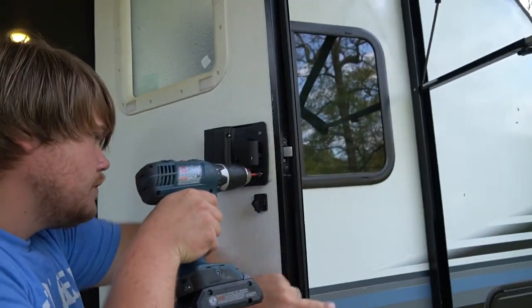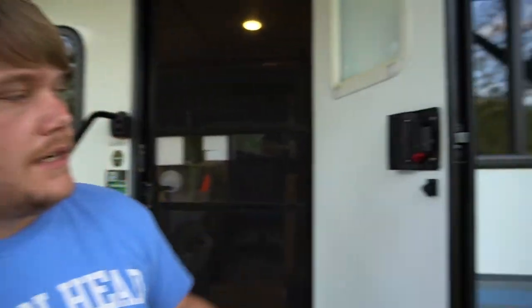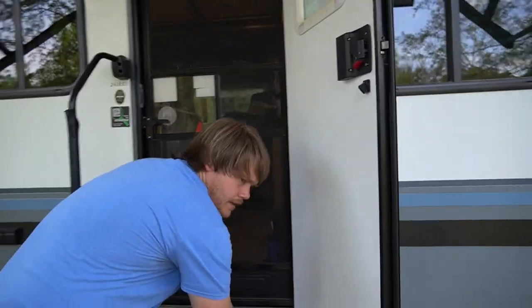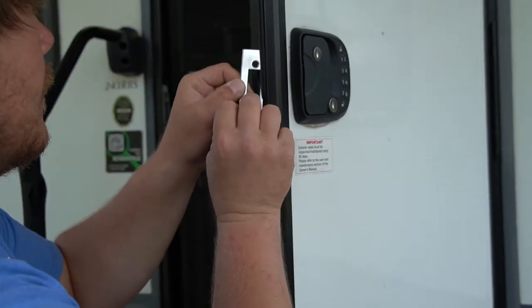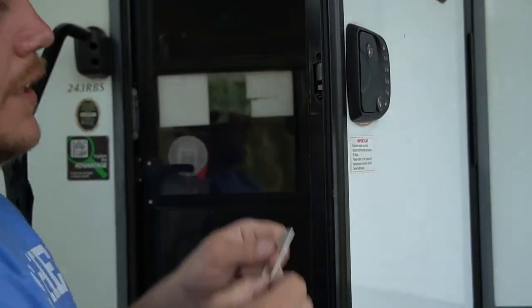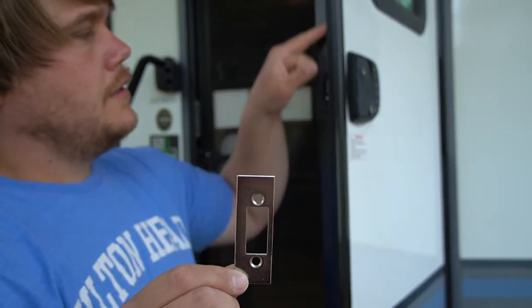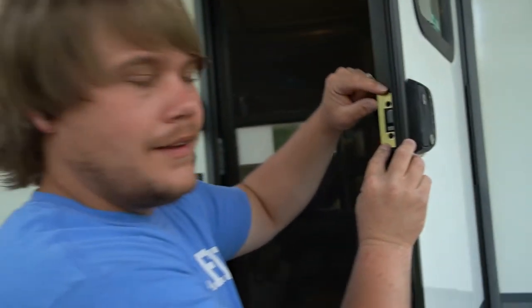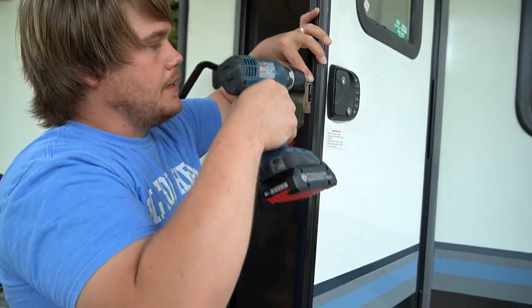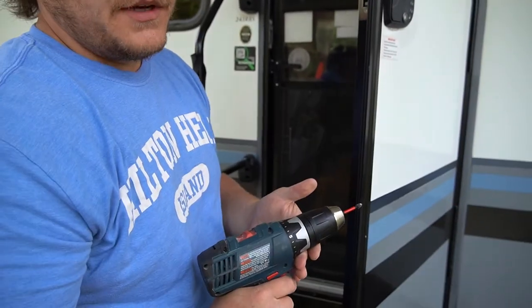Now that we have it sitting in there, I don't have it very snug yet so I can still shift it back and forth if needed. Straighten it up so you can put on the new strike plate. The strike is cut off to one side — look at how yours is on the door, because the skinny side is typically closer to the weather seal so it fits up nice and square. Once you get it set in place, start tightening everything up. Important: if you have an adjustable drill, take the torque down, because it is just sheet metal and you'll tear it out.